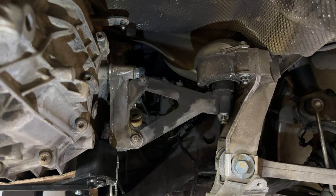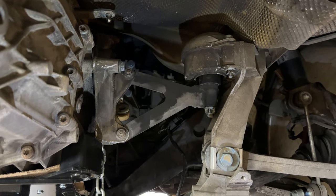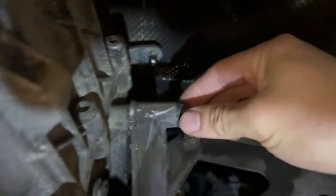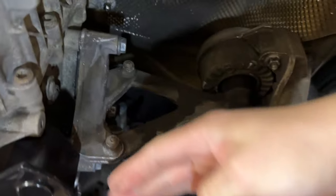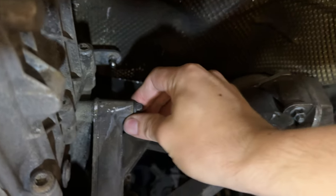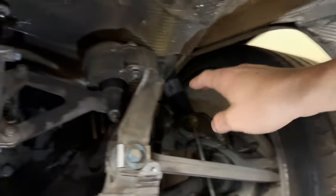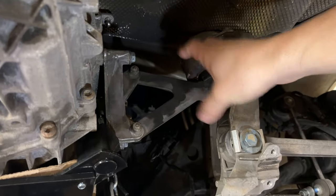Chapter 21: reinstall the right side transmission mount. To get the right side transmission mount back in place, at first it's at an angle. If it's not at the right height, play around with your transmission jack. The chain was a little in the way but ultimately you thread the bolts in by hand as much as they're threadable because they'll be at an angle. Starting with the top ones, I used an impact wrench to actually pull it in, and as I was bolting the top bolts the transmission jack kind of aligned, so you put all the bolts loosely — it aligned to pull itself tight.